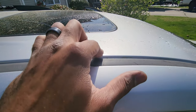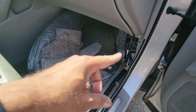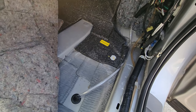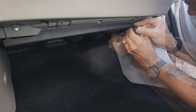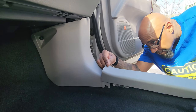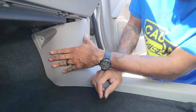You can hit the holes up here with pressured air and it will blow any dirt out of the tube if you do get dirt in it. With the tube sitting in the cavity before, you could blow pressured air through here all day long — all that shows you is that your drain tube isn't clogged internally, but it won't show you it getting clogged inside the actual vehicle because the air just comes out the bottom of the tube into that cavity. Hit that like button — I really appreciate it. I hope this video helped you guys out, solved a bunch of people's problems, and saved them money from the dealership.